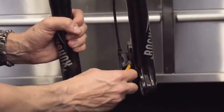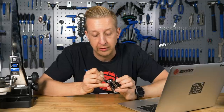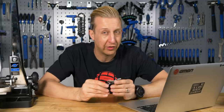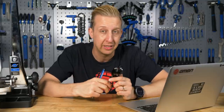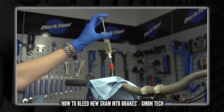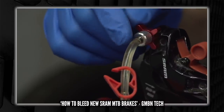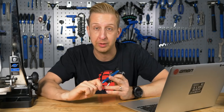You'll find you have to push them quite firmly - a tire lever is good for this, because it won't damage the actual surface of the pistons, and it lets you put a decent amount of force on them, because they have to push back past the O-rings. It does sound like air has got in somehow, so the only real way around that is a proper bleed. Learning to bleed your brakes is quite easy - it's just like bleeding a radiator. We've got videos on those; I'll put a link to bleeding SRAM brakes in the description, and from there you can click through to a Shimano one as well.